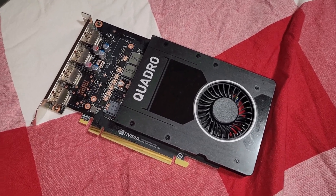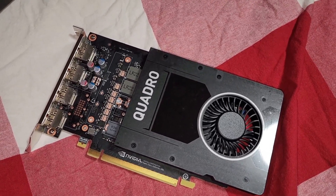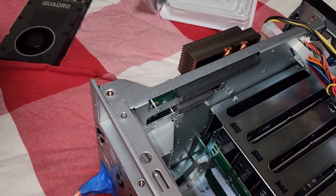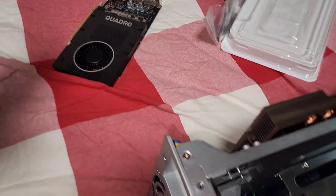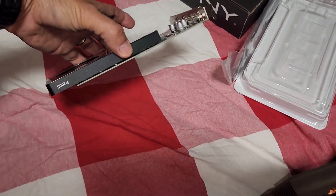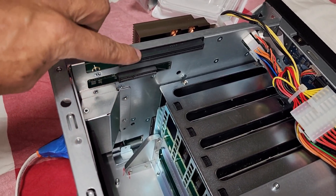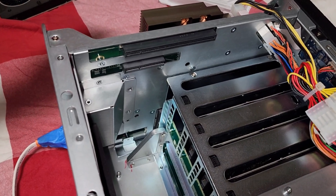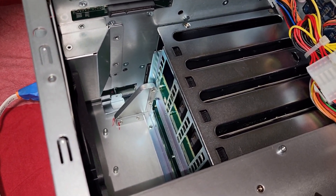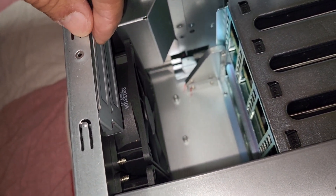This is a professional-grade card, and the reason it has to be this size is because we don't have enough room to install a bigger video card. That way we're going to be able to use the bottom bay — otherwise we'd block it and it would get screwed up. We have to remove this piece right here, the screw in the back, and also the power supply.